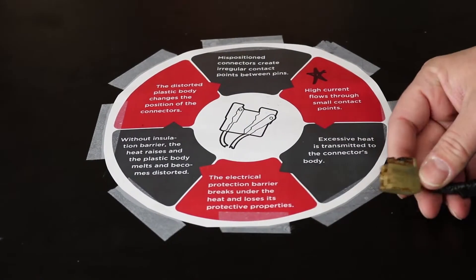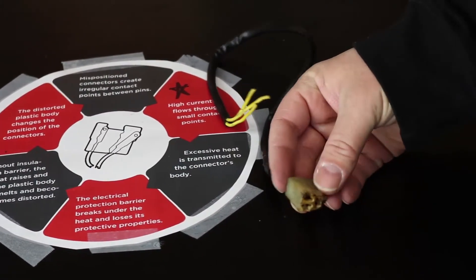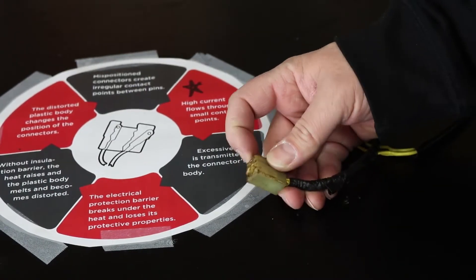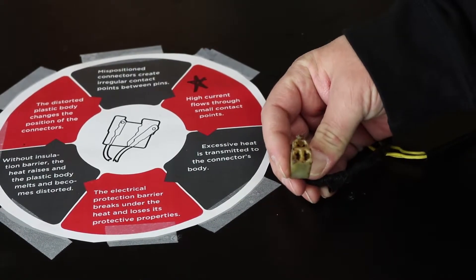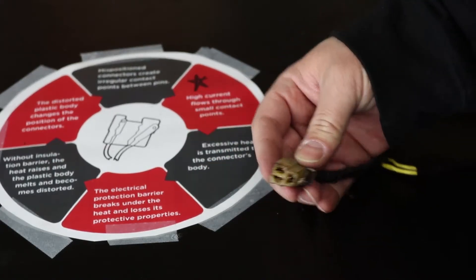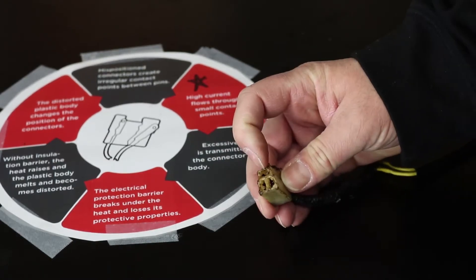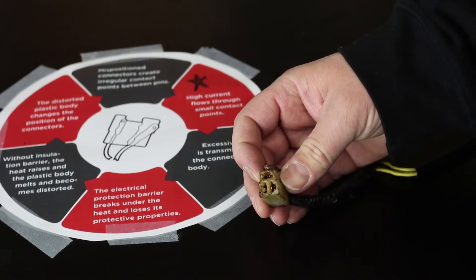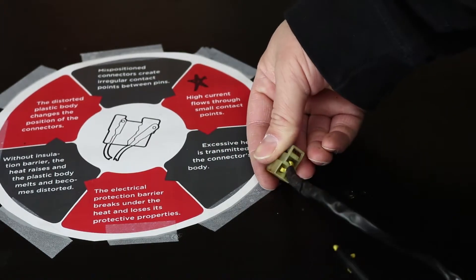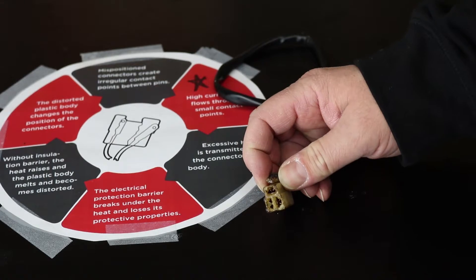Here's a good example of a really badly damaged connector. This is a common style of connector used on a lot of motorcycle stators and ATV stators. You can see how badly this one is melted. This was on a stator that was used with a regulator that had failed, which caused this whole chain reaction to start. As it gets hot and starts to deform, the terminals inside actually shift so they are no longer clipped in their correct position. This can cause them to press out the back of the connector as the locking mechanism fails, or just cause them to sit crooked in their housing so they don't make good contact.